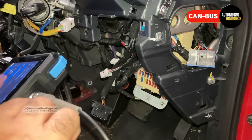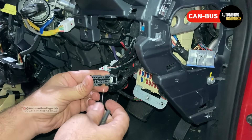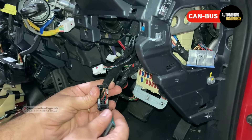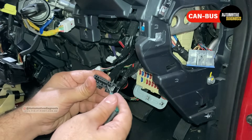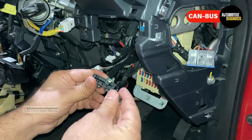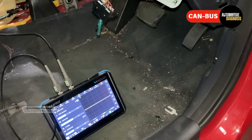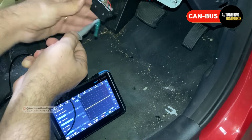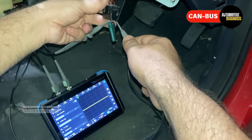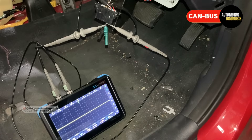Both channel one and channel two are now set up. On the OBD2 connector, pin number 6 and pin 14 are for CAN high and CAN low. Looking at the back, the red wire is CAN high and the blue wire is CAN low. I insert the probe tips here — the test probes are really thin so they won't damage the pins. I put the green one on CAN high and the black one on CAN low. The oscilloscope has a stand at the back to make it easier to work with. Channel one is on CAN high, with the black alligator clip connected to ground, and channel two is on CAN low on pin number 14. Now I need to turn the ignition switch on to read the waveform.